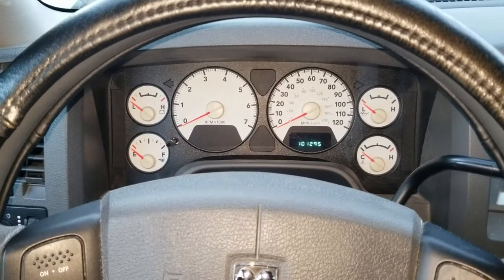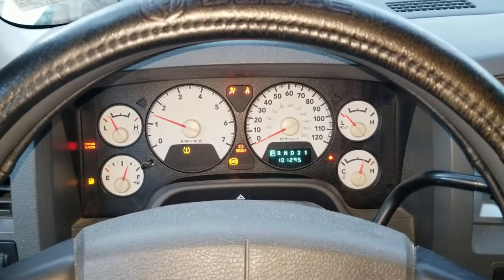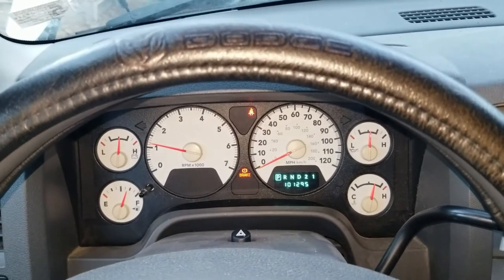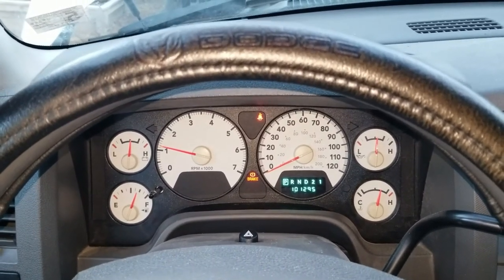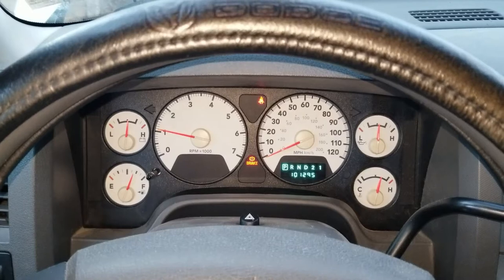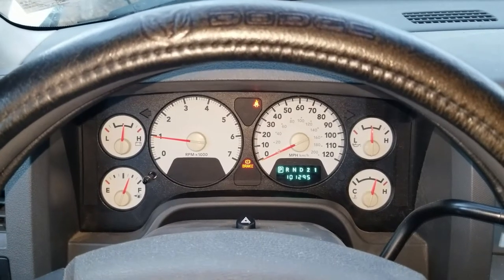Everything is buttoned up under the truck and now it's time for the moment of truth — we are about to find out if my repair worked. Here goes nothing. Nice — that is a good sound! Now, because I had the battery disconnected, that would have cleared the check engine code. So I'm not going to check it with my scan tool right now because that code is going to be wiped out. I'm going to let it run for a while. If it doesn't die, then I'll probably take it for a test drive in the neighborhood, hit a few bumps, and see if I have any more issues. If not, then I think I can be pretty confident that I found the problem.